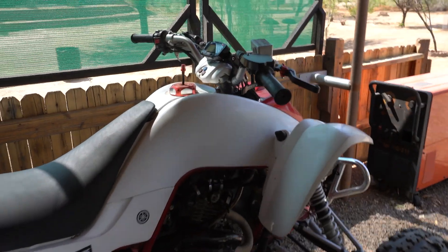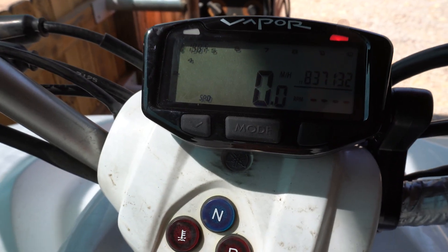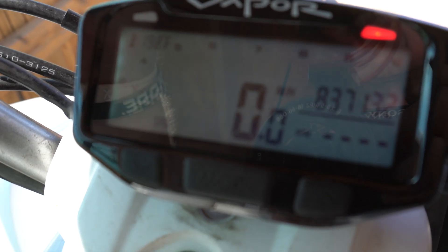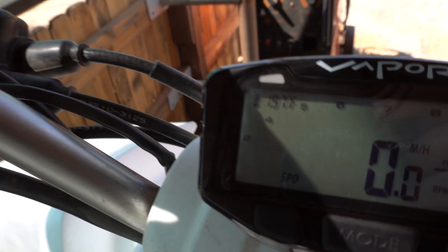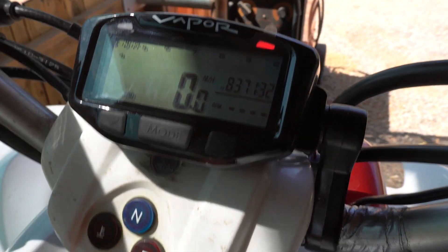We took it out for a quick ride. All of our wires are tucked up — speed wires underneath, 12 volts running perfectly, temperature gauge tucked up underneath there. We took it for a ride and you can see on the display there's a red warning light on — that's because I set the water temperature warning to trigger above 190 degrees, and we're currently sitting at 197 degrees.